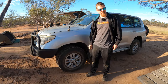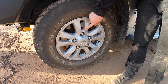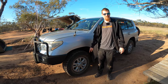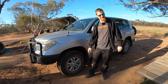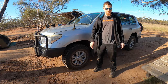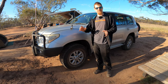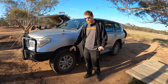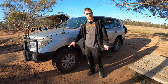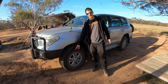Being a fairly early model of the 200 series, this has the 17-inch wheels, which are actually quite desirable. On eBay there are loads of 18-inch wheels for sale from people wanting to upgrade their older Land Cruiser, but 17 inches gives you a much wider range of off-road rubber than 18. The situation is changing as newer four-wheel drives come with 18-inch wheels and more off-road rubber becomes available in 18s — similar to when this vehicle was new and everyone complained that 17s were too big and the good rubber was only available in 16s.